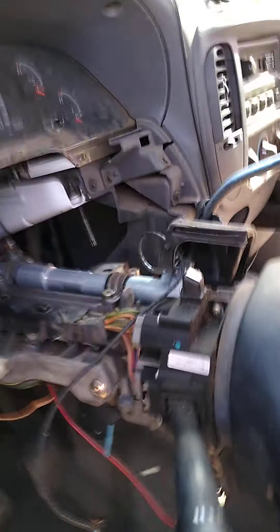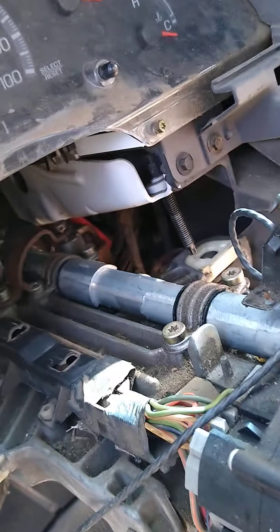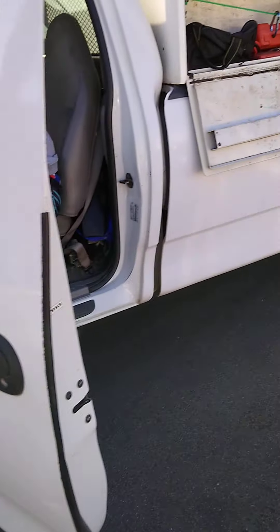Take all this bottom stuff apart and get up underneath. If you haven't done it before, it's going to take you all day. Find the bolts that hold the steering wheel up — normally it's way up in a higher position. You can see those long screw holes that hold it up normally. Take apart all that and just drop it down, and that gives you the access you need to get to the broken part you need to replace.